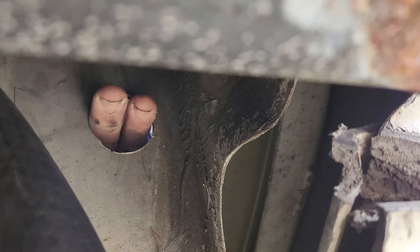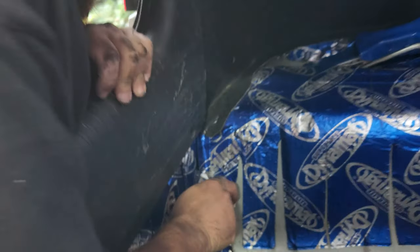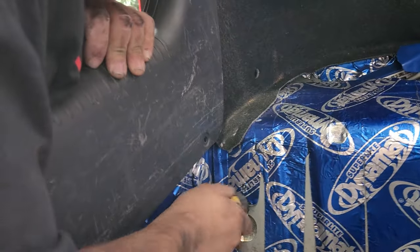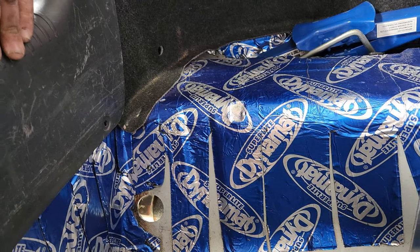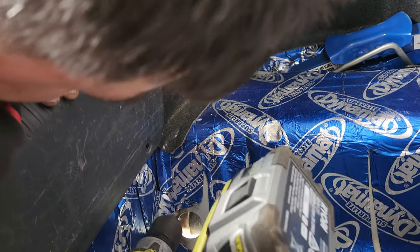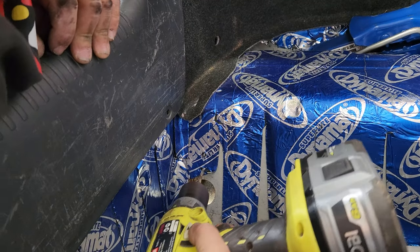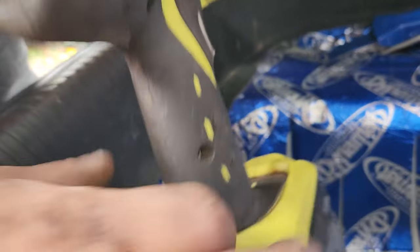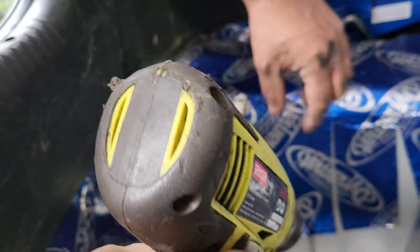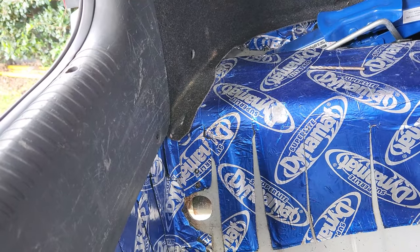What can I do now Sean? Pull some holes. We're going to do one massive elongated hole so we can zip tie all two hoses together, and then we're just going to silicone them for waterproofing where we need to. Just don't want to go too high because then it'll actually cause a kink underneath the body, and we don't want kinky hoses.